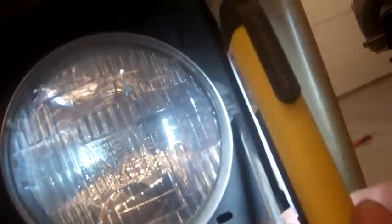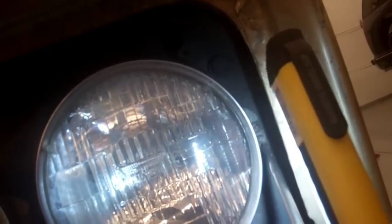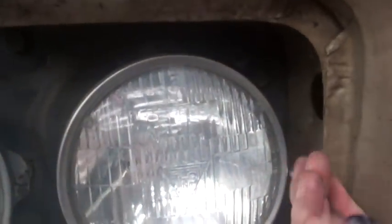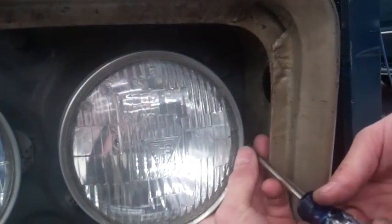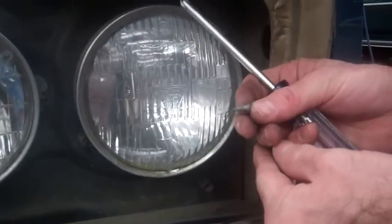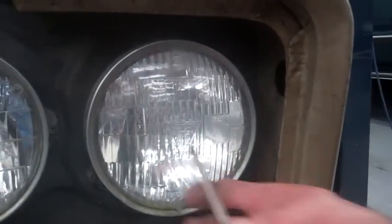And the same goes for this side over here. You notice we have 2 screws on this side. We have the larger screw, which is for adjusting it left to right, and we have a small screw, which is for taking off the ring. So we only want to take off the small screws used for the ring. So I'm going to take those off right now. These screws are very small, so please try not to lose them, because they're becoming harder and harder to find.